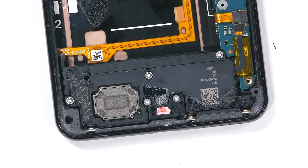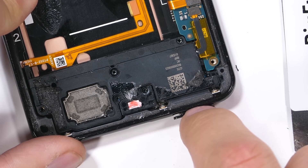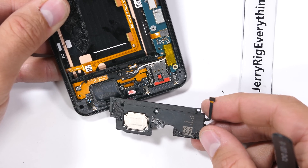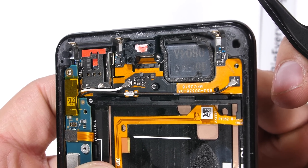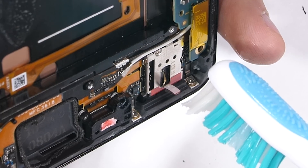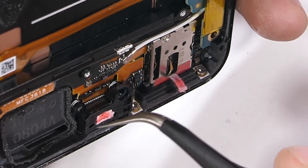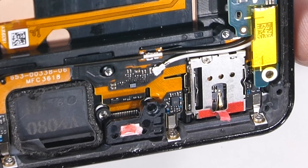No match for the Note's 4000 milliamp hours, but still better than the iPhone XS's 2700 milliamp hour. Down at the bottom of the phone we have one of the two stereo speakers held in place by five T3 screws. I'll pop out the SIM card tray and remove the speaker with its black plastic covering. The interesting thing about this speaker is that sound emanates from just one side of the charging port, meaning the extra large bottom speaker grill is mostly for aesthetics. We also get yet another water damage indicator running along the entirety of the SIM card opening — one of the largest I've seen. If it gets wet, it turns red, and this indicator is also visible from the outside when the SIM card is removed.